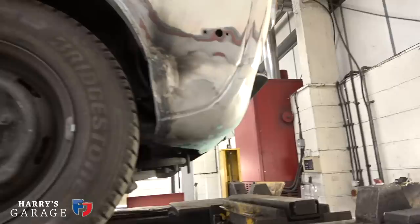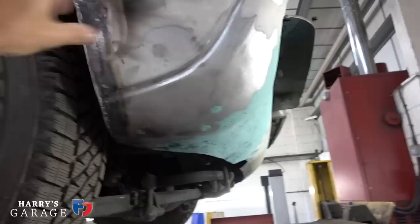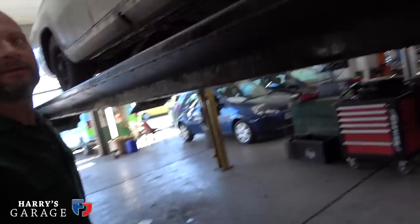The car is now structurally sound. There's a new quarter panel here with the original crease nicely reproduced. You've got to remember the bumper wraps around here too. There was also a little bit of corrosion on the chassis in that corner, so they just plated that up as well. Everything is now structurally sound - the MOT tester is going to love it. Darren is himself an MOT tester, so that's a good sign.